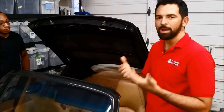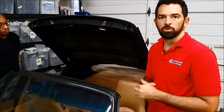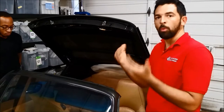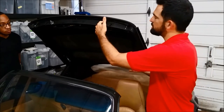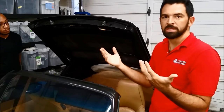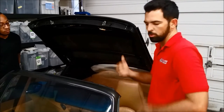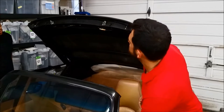Now in order to go backwards I don't have to hold anything more except the switch on the dash of the car, and when I hold that to open the convertible top these latching motors are getting disengaged. The internal micro switches are also going to disengage, and that's how the convertible top knows that it can roll backwards.